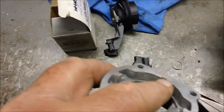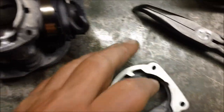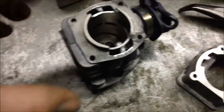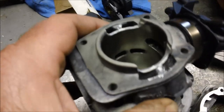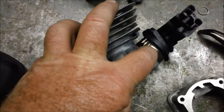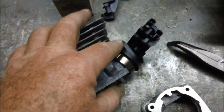I take the bearing cap and die grind a channel right to that point there so it can help it with pulsing. And this is that modified 346, 42 millimeter top end. Now, of course, it's going to get the Husqvarna OEM steel banded manifold. That's going to help reliability downstream.